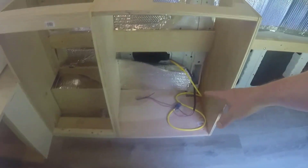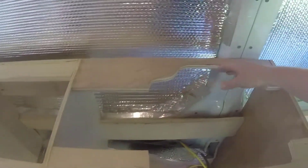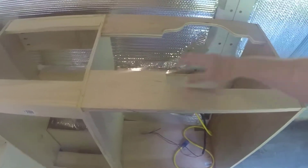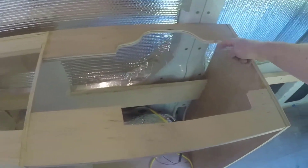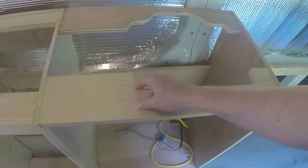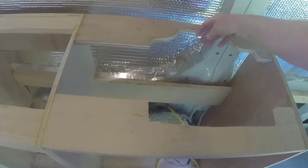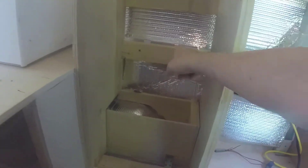So our water is going to go on this side. Water pump over here. I did cut out the raw cutout for the sink. I'll make a template of this and then we'll make a more precise cut just for the bowl on the finish counter. This little piece here is where the faucet area is. I had to cut that piece back a little bit, but we'll put a cabinet there and I'll use that backboard there.